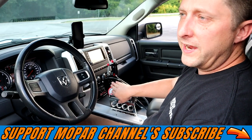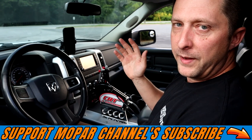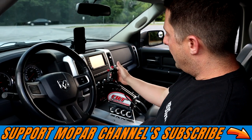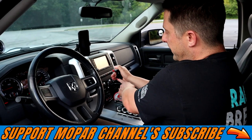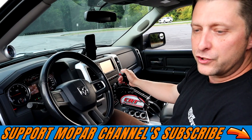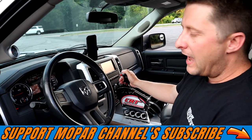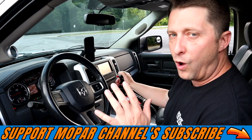All right, so we're in first gear, and if I let off the brake, you're gonna see we're gonna roll a little bit right there. So I'm gonna mash the trans brake button right now. As you see, the light's engaged. I'm gonna take my foot off of the brake, and the truck is gonna stay put. I can floor the gas pedal right now if I want to, and this truck will not move at all.